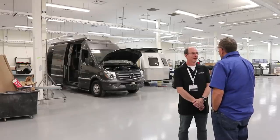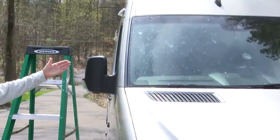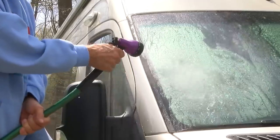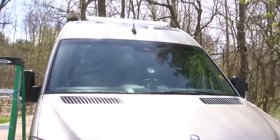The last thing mentioned is the importance of hands-on maintenance. You're a big advocate of washing your vehicle yourself. Besides making it look better, anytime you physically wash or put your hands on your vehicle, you identify a change — a change from the last time you washed it or looked at something closely. For example, if you're washing the grille and you look behind it and notice you took a stone into the radiator with bent fins, that repair is now something that won't cause a breakdown later.